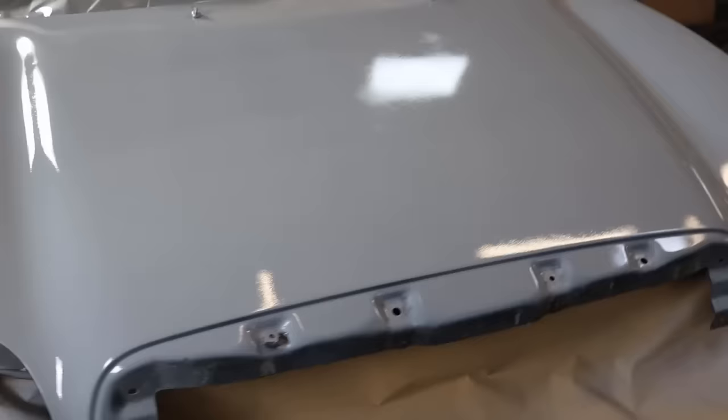So I've put two and a half to three full coats on. At this stage you shouldn't see any of the previous clear coat damage from underneath. You should have a nice smooth even shine the whole way across the hood. Don't mind little imperfections because you will be sanding this primer before you put on the base coat and the clear.